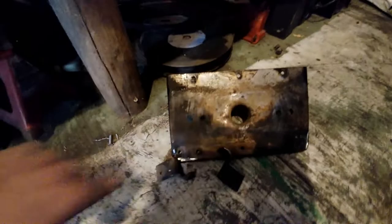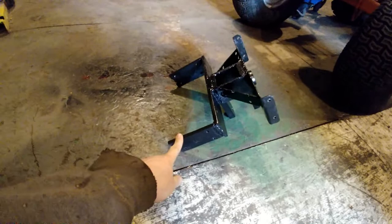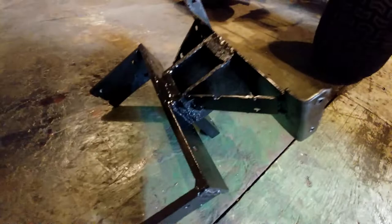I'm going to be painting those up. I already made an attachment — it's over here. I cut out the original bracket. This old front end opens up here — three bolts go up there and four on the sides. That's the original bracket there. As you can see the dimple where the old axle assembly was. So on this I got some half-inch steel plate, drilled four holes, tapped it so the screws go in nice.